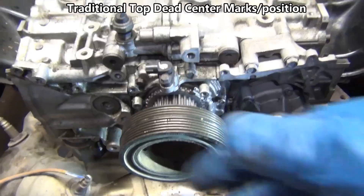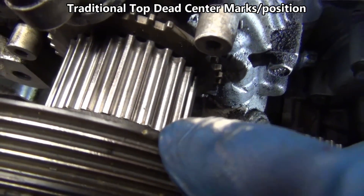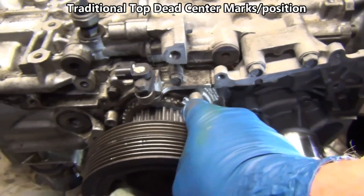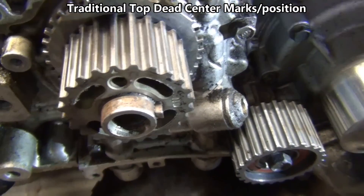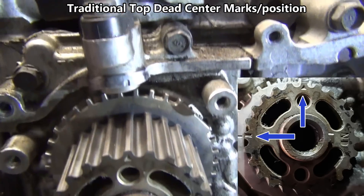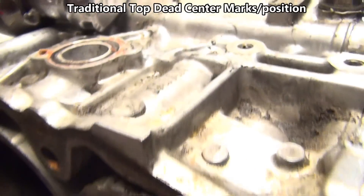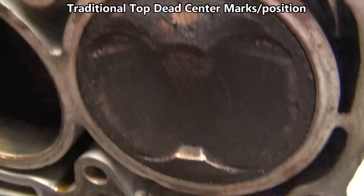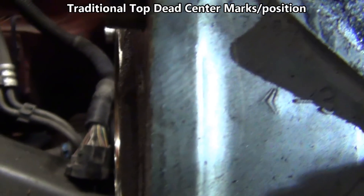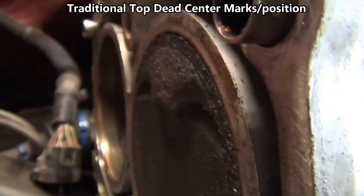With the cover removed, we still have these same marks — that little nick is still there. I pull that off and look at the keyway on this: it's to the right, but the marks for doing the rest of it are different than that. In this position, this is the number one cylinder — it says number one right here — and the piston's all the way out, just like you see here. That protrusion fills up the space so it can have better compression.